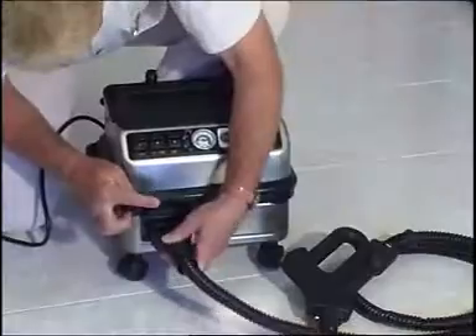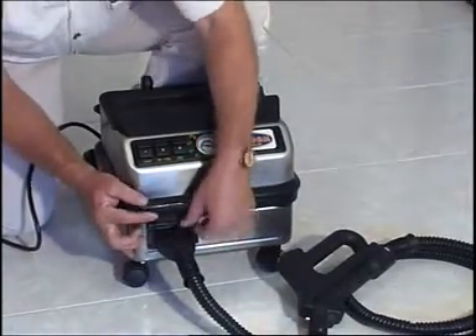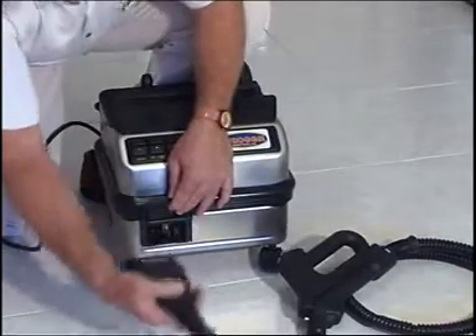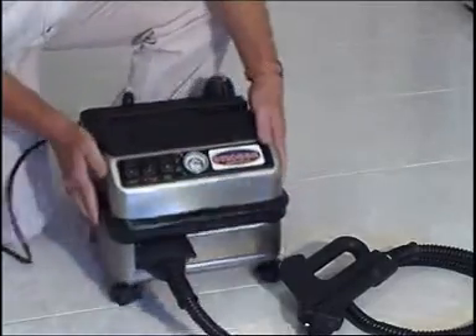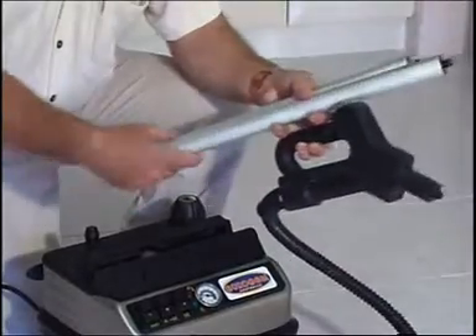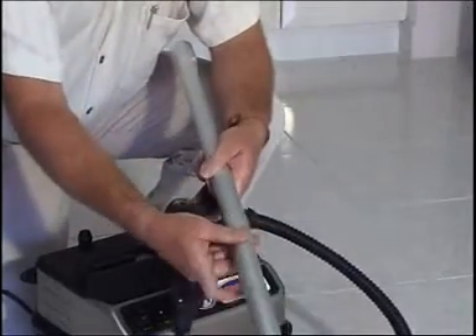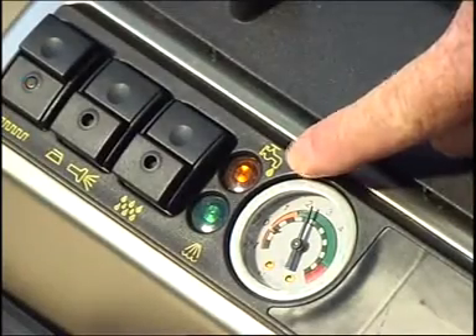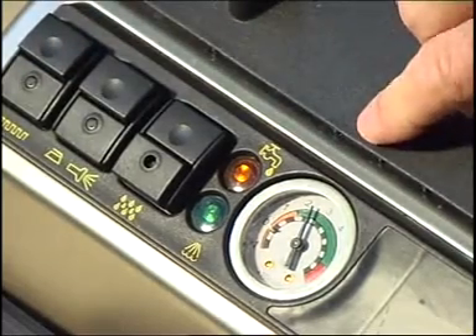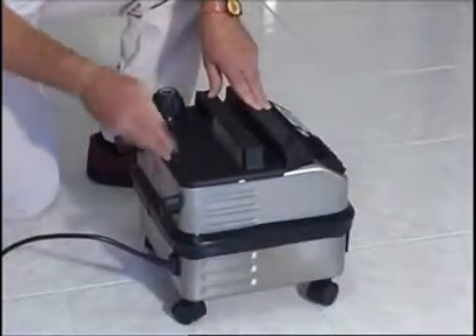Now let's get your home cleaned and sanitized the natural way. The main hose or flexible tube fits into the socket at the front of the unit — make sure you hear an audible click to ensure proper connection. It is important to treat this hose with respect: it should not be used to drag the machine around, nor should it be jerked or twisted excessively. The accessories can fit directly to the main hose nozzle or to one or both of the extension tubes depending on the task. Turn on the second or metal switch on the SC4000 to power the hose and accessories. You can adjust the steam pressure by turning the pressure knob clockwise.